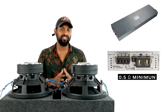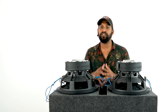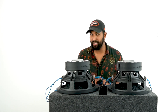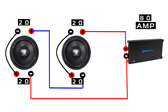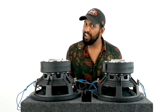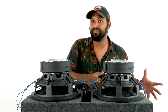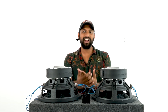The type of amp you want with this configuration is one specifically built to be half-ohm stable. If you run a 1-ohm or 2-ohm stable amp at half an ohm, it could cause the amp to go into protect mode, so really match this up with a half-ohm stable amplifier. There is another wiring configuration — series wiring — which is not very common because of the power you lose. If you feel like you're not getting the power you want, double-check that you're not wired in series. I hope you found this helpful. I'm Mike from Rockville — see you next time.